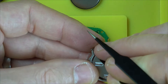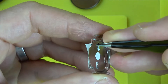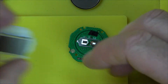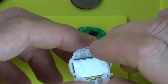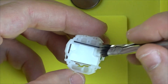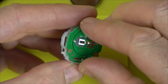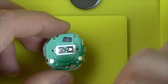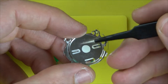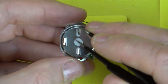You can see they're sticking right down now — this one here and this one here. So let's place this back on and see what it's going to do. We need to make sure that this zebra connector here is really clean — can't have any dust or anything on that. Let's place this on here like so. Now we're going to place the battery on here. I'm just going to put these two tabs down a little bit as well to make sure that it's making a good contact with the battery.